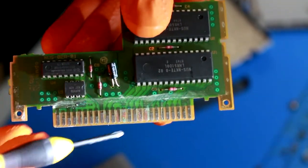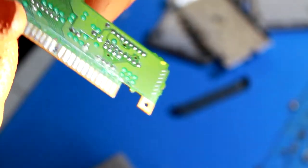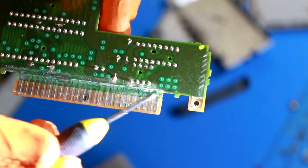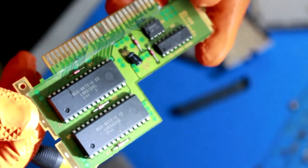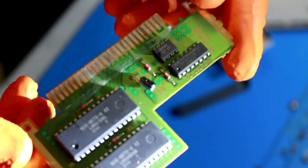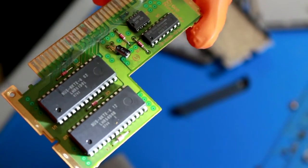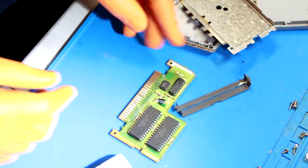There's all kinds of nastiness going on right there on the chip side. It looks like this pin has been corroded all the way through - you can hear some of that. That one's bad. What I'm going to try to do - since I have a ton of Japanese versions of Mario Kart and it's not quite as valuable - is maybe just swap the ROM chips over. But I'd rather try to get this working if possible.